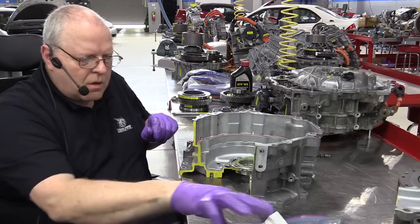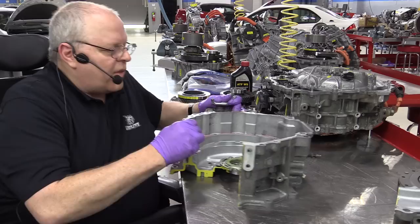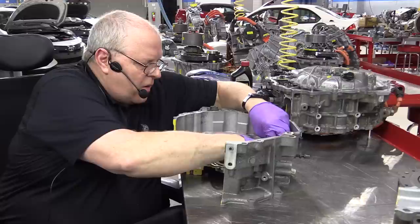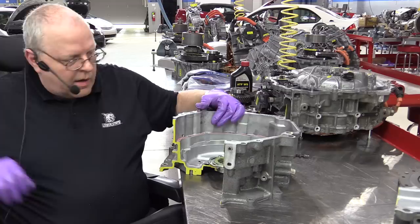All right, so the resolver harness sticks up through here for the electrical connection for the MG1 three-phase wiring. There's a bracket and a lubrication pipe right here that will hold that harness in place and keep it from contacting the rotating rotor and interfering with the rotation